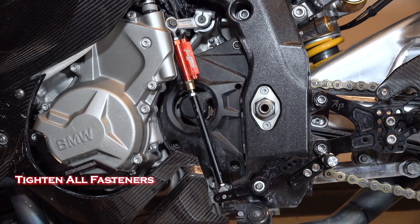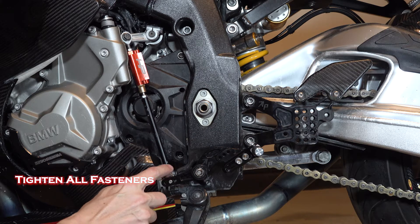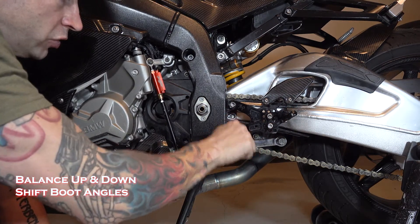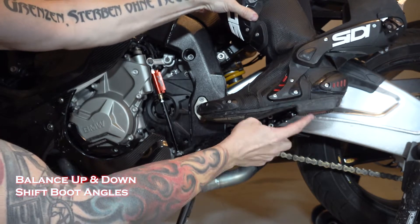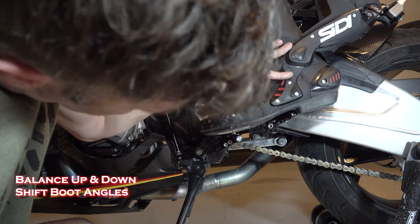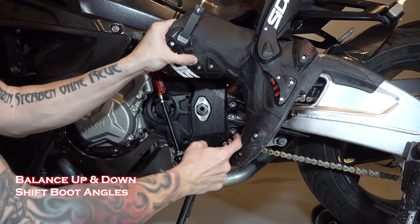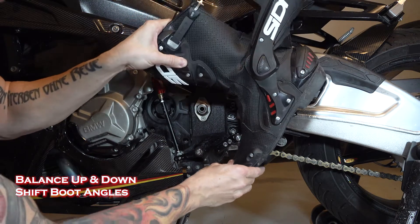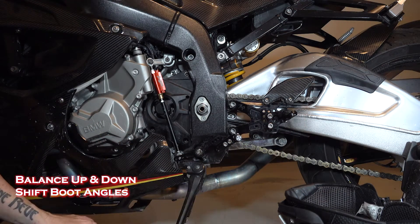I'm going to go ahead and tighten this back in. Make sure all those nuts are tight. This bottom one with the double groove in it — that's a reverse thread. I found that out the harder way. The last place we're going to look is from the foot peg to the shift knob position. Make sure it moves smooth. Now let's see what angle our boot is actually going to be sitting at — if we have the boot on the peg and come down here, it looks like a pretty good flat spot. Going up from here it's kind of pushing at an angle. This position looks good, but this other one, not so much — it's still pushing at an angle a little bit.